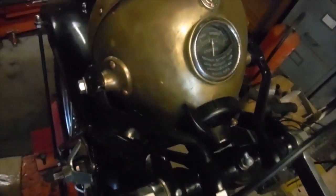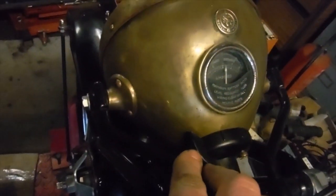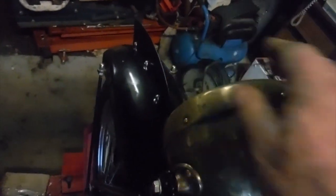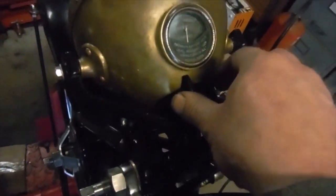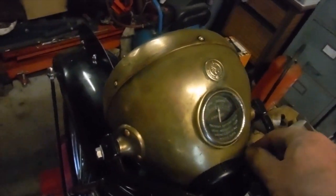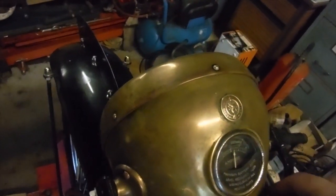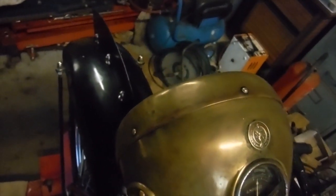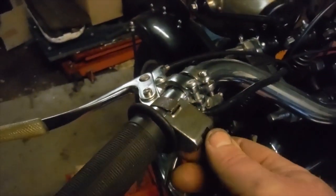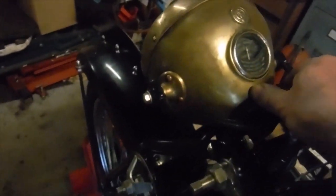And we've got off, obviously. The first click when it's running puts the front side light on its own. Next click, front side light and the tail light on the rear will be on. And that click, the last one, obviously puts the side light out and the headlamp on, and the tail lamp also stays on. And then we've got the usual dip switch.